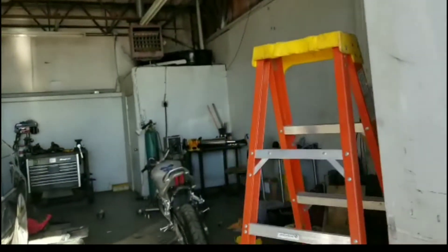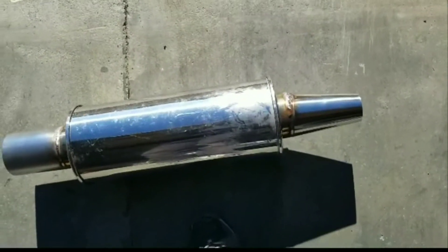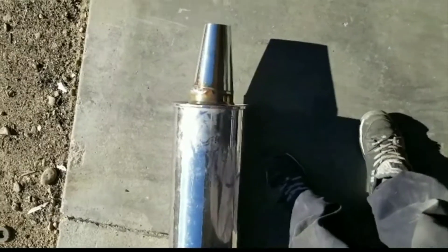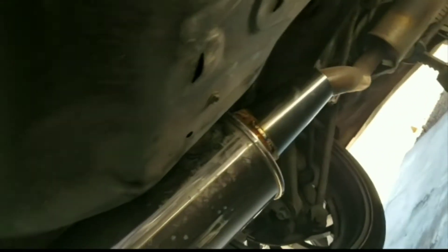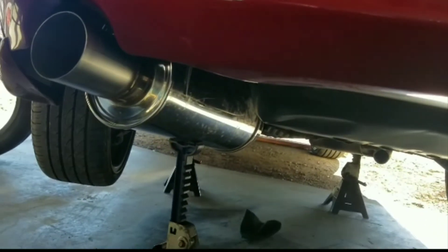Surprise surprise, I bought a Supra - some might know, others probably don't. Alright, there it is all welded up - looks super shitty because I never sharpened or cleaned the tungsten after dipping it 500 times, but no one's gonna see that part. This is pretty much where it's gonna be. I did the reducer that goes to about two-inch piping, so I have gaps to fill with the MIG, but I'm no stranger to doing that.